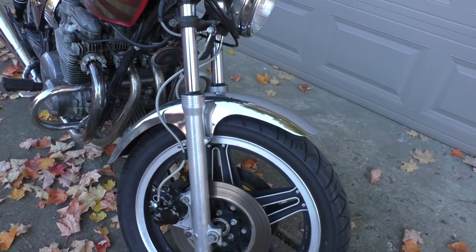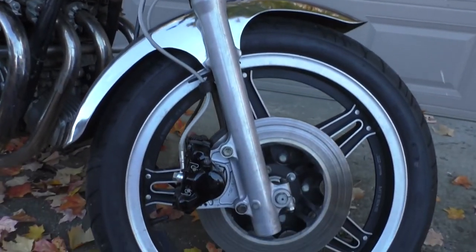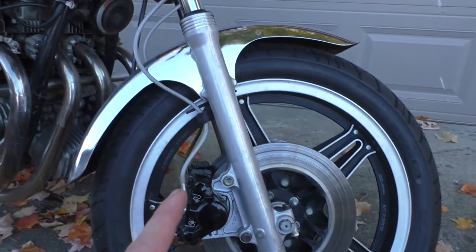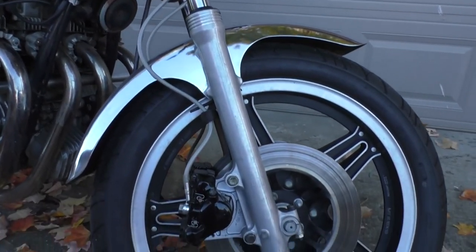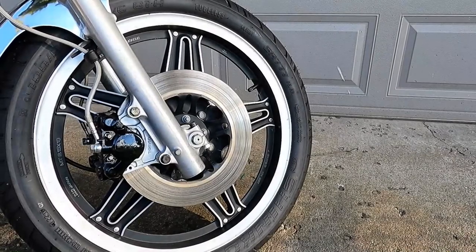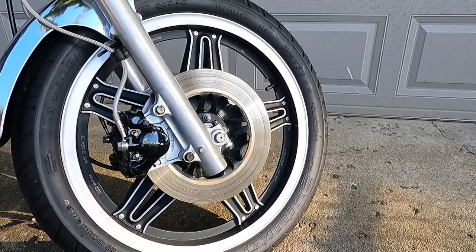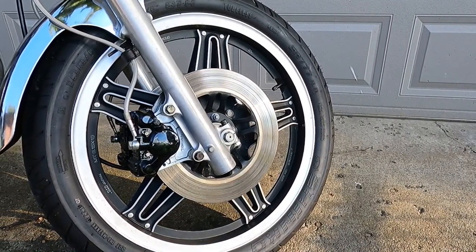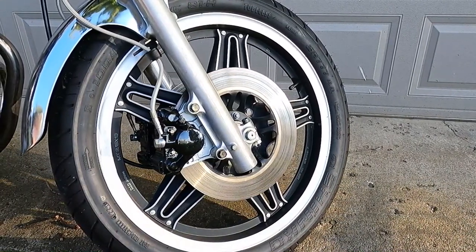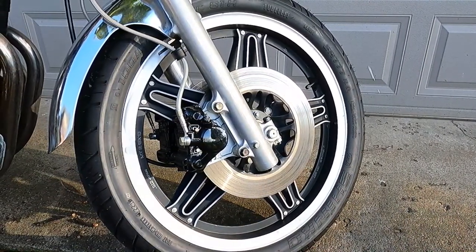Next up are the front shocks. We did a full rebuild on these shocks — just look at the previous video and today's video to go over that process. And off camera, I went ahead and repainted the calipers and added these stainless steel brake lines to the front disc brakes. This bike is from 1981, and these stock lines were pretty much just worn out and they didn't work very well. After I installed those stainless steel lines, my braking on this bike is freaking awesome. So if you're looking to modify your braking system, definitely check out those stainless steel lines — they'll be down in the description.